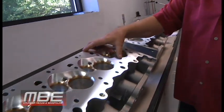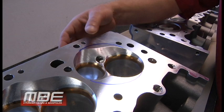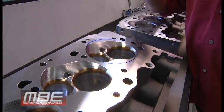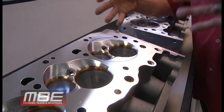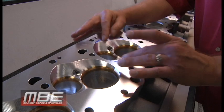So this is Quench. It's very simple. It's just a flat area. And as we went through 1985 to 1995, we thought, the more Quench we can create, the better off we are. That was promoted with flatter valve angles and things like that to get this area here.